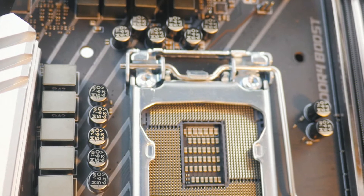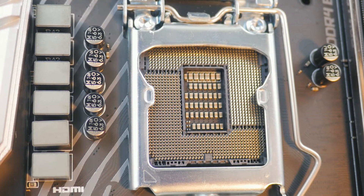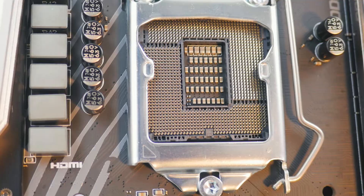For starters, this motherboard is for the latest i7 Coffee Lake CPU lineup — that includes the i7 8th gen CPUs. It is not backwards compatible with any of the other generations like the 6th gen and 7th gen, although it uses the same socket, which is quite confusing for some users. So if you have 6th or 7th generation Intel CPUs, they are not compatible with this motherboard.